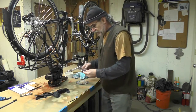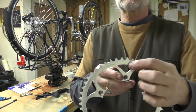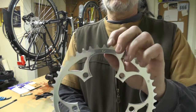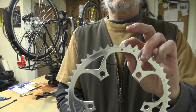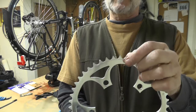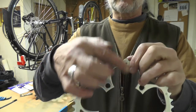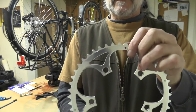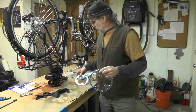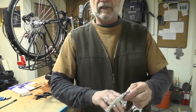On all three of these there's a little reference tab — there's an actual arrow. On the other side of the arrow there's a little screw hole, and the screw hole has that little dropout pin that goes between the chain ring and the crank so that the chain doesn't fall in between. All the chain rings have that little arrow, and all the arrows line up.